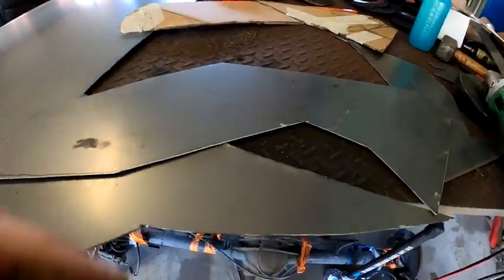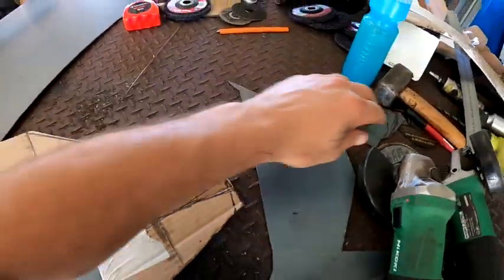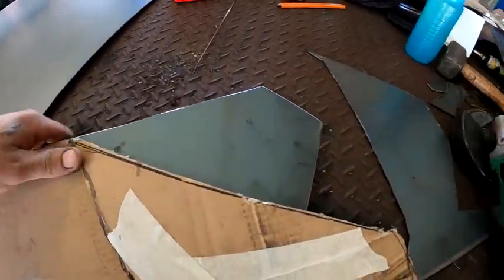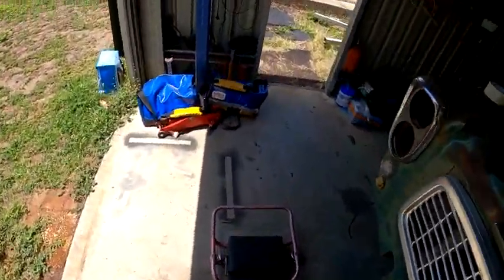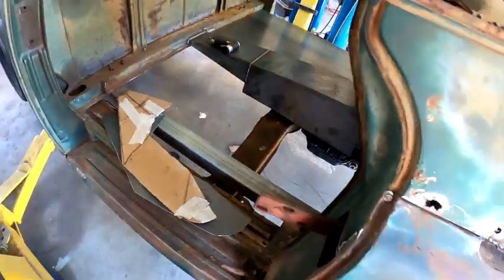So we've got that piece cut out. We'll tack it back over with our template, and we'll work out our fold lines, mark it out, give it its first couple of folds, and just trial fit it, and cut and grind until we're happy with it. So I'll spare you the process, but that's what I'm about to do. Reconvene when I've got it sorted out.